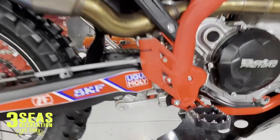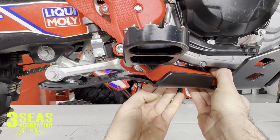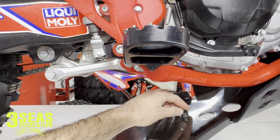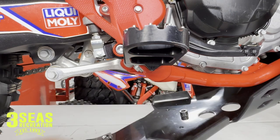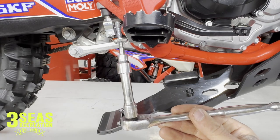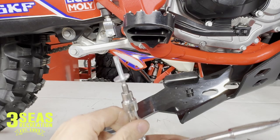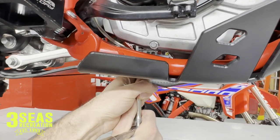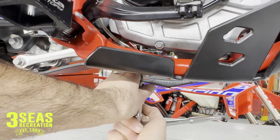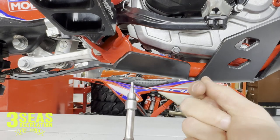By sucking the back of the bike down, it did help quite a bit actually. Now I'm pretty much just fighting the front of this skid plate — I can get that up in there really easily and get the bolt started. With the newer TM Designs, that plastic washer is kind of moving around rather than one piece, but at least now they're sticking that to it. To get the most leverage, I'm using a socket with a ratchet instead of the standard Allen key. That worked out really well — I could apply a ton of pressure while twisting and that let it catch the threads.